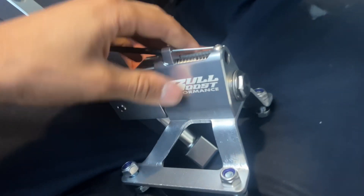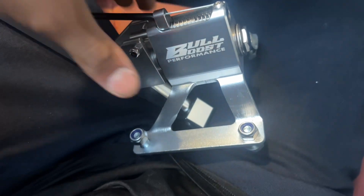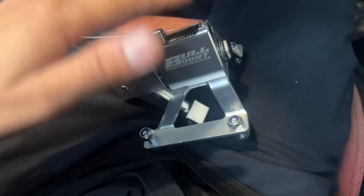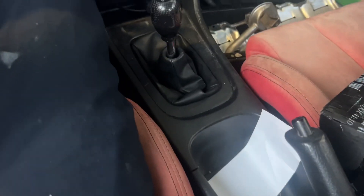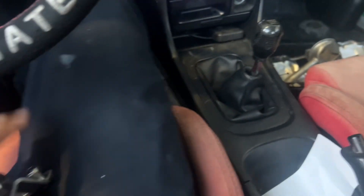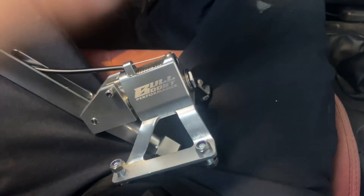For the most part it should be a pretty simple install. The best part is he's not going to use the stabilizer mechanism anymore — this right here is the stabilizer with a spring, and that's why he bought this product. All he's going to use is the actual joint piece that makes it go into gear. It should be a lot shorter shifting, and this is going to be his whole new shifter. You do have to drill some holes for the front or back ones.